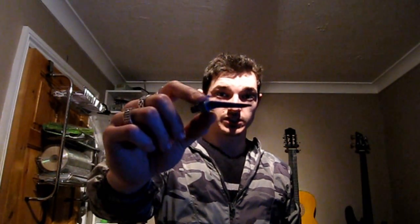Now if you can't find any information on your needles or cartridges, perhaps you've got rare ones or they don't make these ones anymore, just take an educated guess. Obviously don't start cramming the weight on, but generally, this isn't set in stone, the head shell style cartridges like these, the type that come as standard on the Technics turntables, are generally between 2 and 2.5 grams, so somewhere between them. And this type of cartridge, the Concorde cartridges, sometimes known as banana cartridges as well, will generally take about 2.5 to 3 grams, so thereabouts.